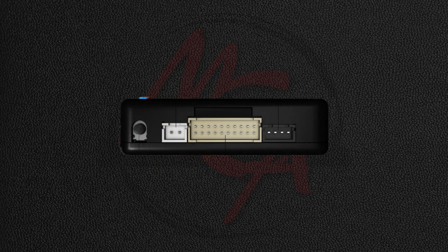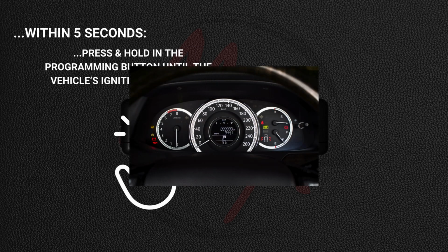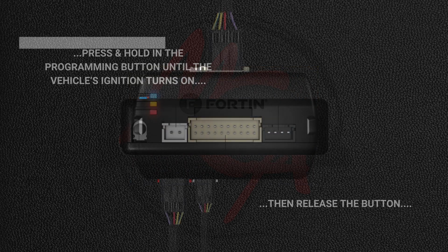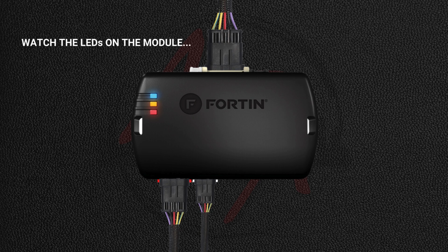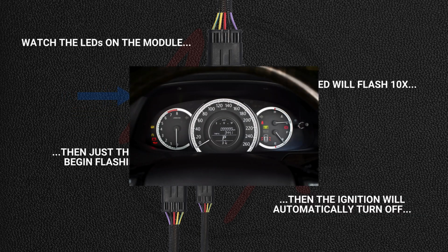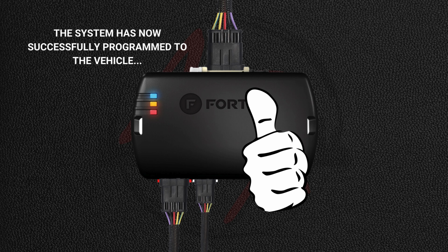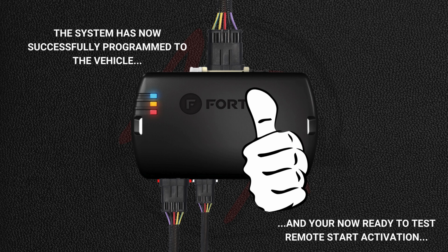Now within 5 seconds, go back to the programming button and hold it in until the vehicle's ignition turns on. Then release the button. Now watch the LEDs on the module. Just the red LED will flash 10 times, then just the blue LED will begin flashing rapidly, and the vehicle's ignition will automatically turn off. The system has now successfully programmed to the vehicle, and you're now ready to test remote start activation.